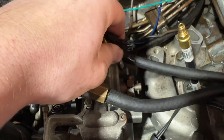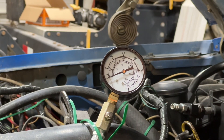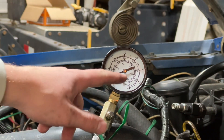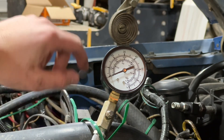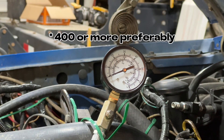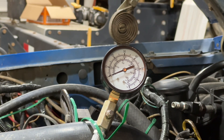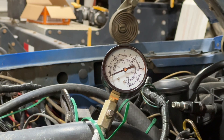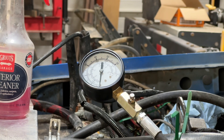I'm going to pull these connectors off so my injection pump has no power to it. I'll set this here so you guys can see — the bottom row is PSI, then kPA and bar on the top two, which we don't really care about. These should all be right around 400 PSI for compression. If they're a little lower it's okay, but if they're a lot lower that's where you'd have a dead cylinder, bad piston rings, that kind of thing. Let's fire this real quick.